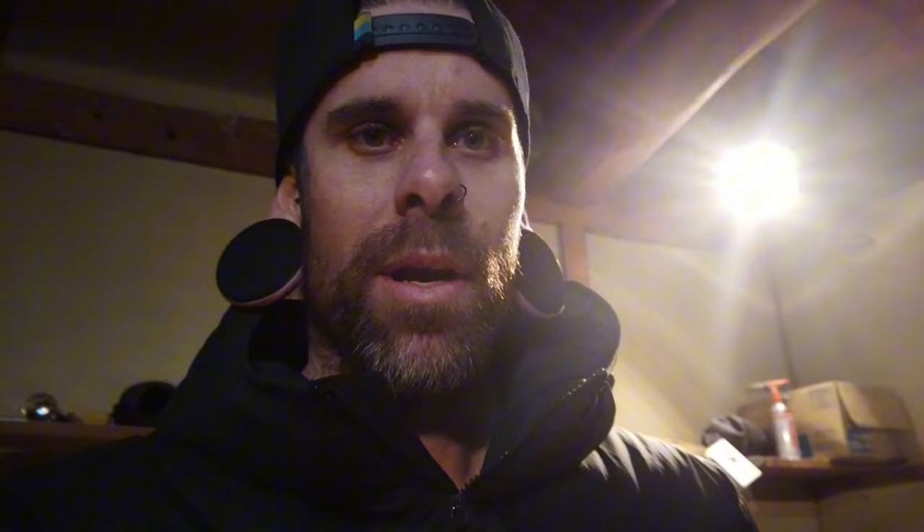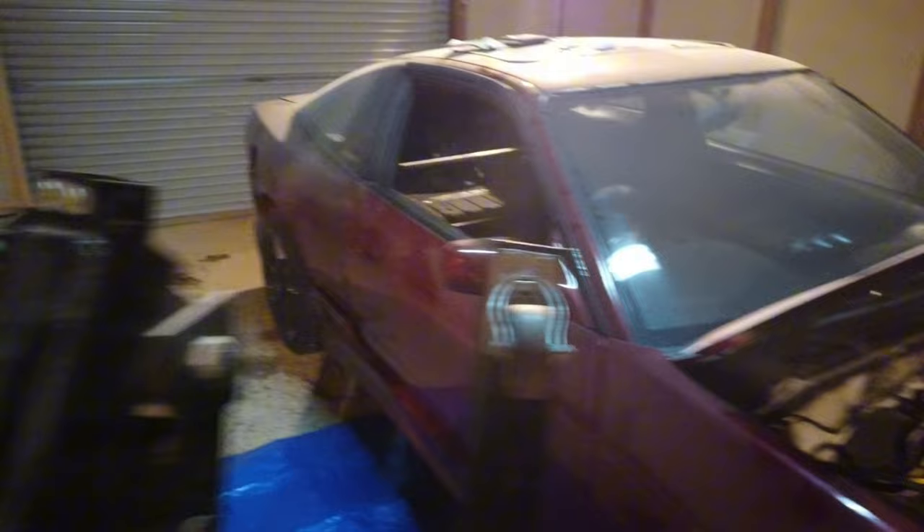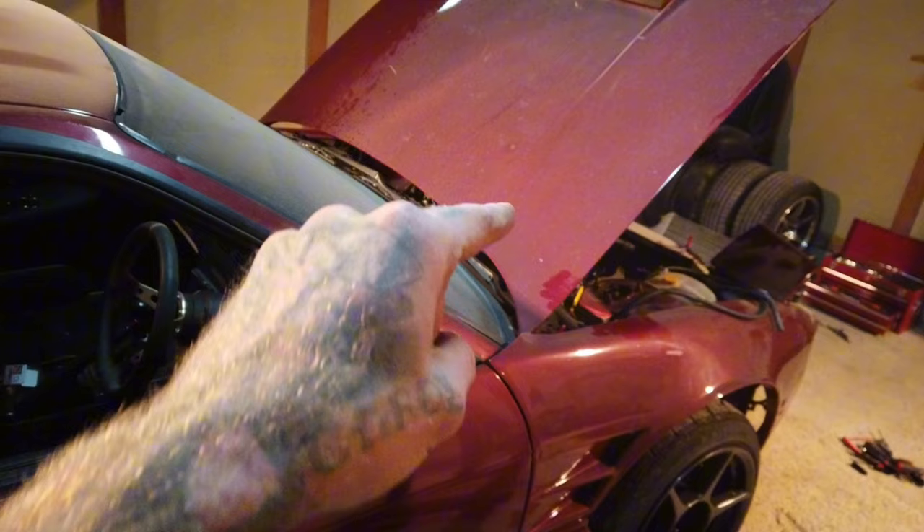Went to Joyful, ate some delicious dinner, now I'm back at the shop. I've put a tarp on the ground so I can get under there to drain the gearbox oil and take the tail shaft out. I need to take the shift linkage out but I don't have circlip pliers - things you don't have when you move countries. I'll drop the back of the box down, take the slave cylinder off, then undo the 14mil engine mounts from the bottom.